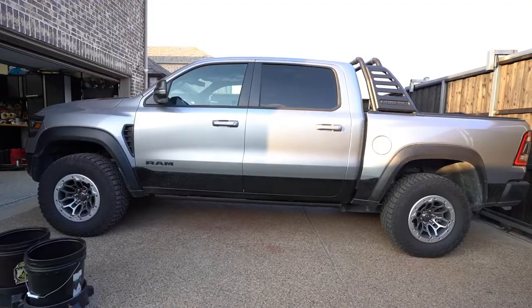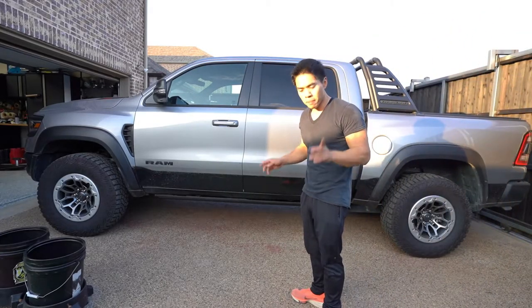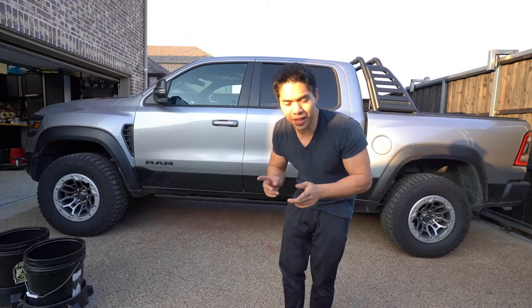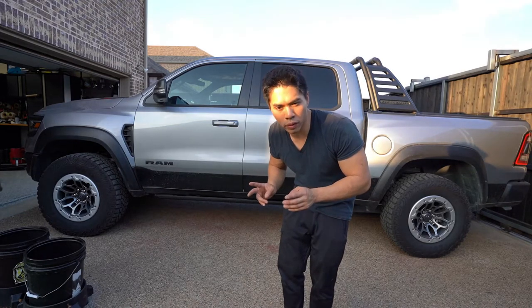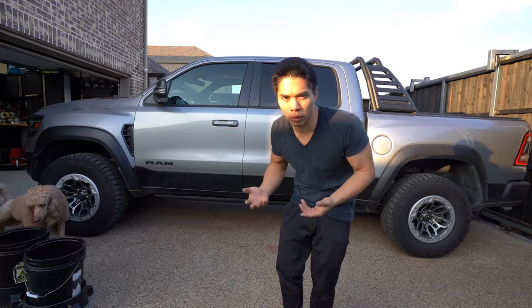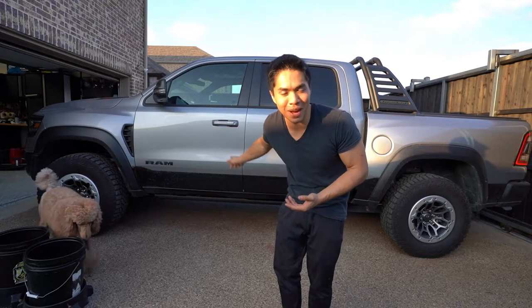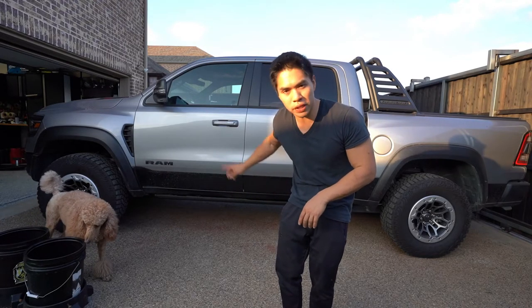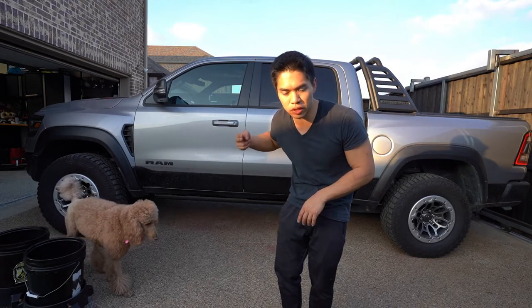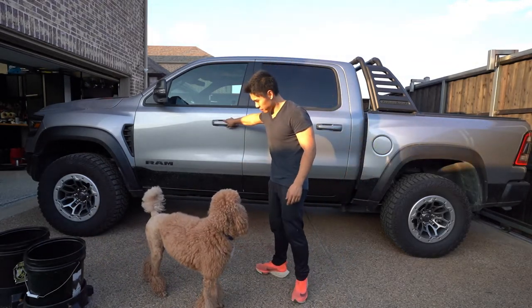Okay, and just like that, I'm done. There are a few things. There's two purple wires that are shown in the video. I got those backwards. Actually, one's a purple with a black stripe on it, and one's a regular purple. I had them backwards, so when I would open the driver door, it opened the passenger. Anyway, just flip that around. Don't forget to take that kick panel off and stick the two-prong pin connector into the side, and it works great.